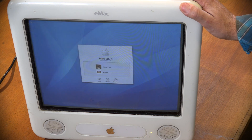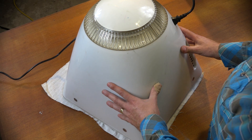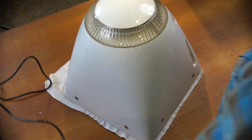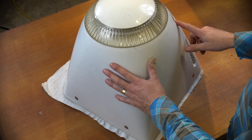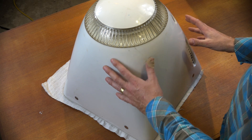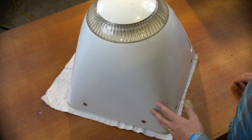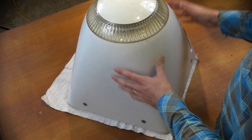I'll power it down and pull it apart - get the original hard drive out to return to the owner so he can recover his files, and put a fresh hard drive in. I'll flip the unit face down on a rag to avoid scratches. First thing: unplug the equipment - whether you have 110 volt or 240 volt like we do in Australia, it's enough to kill you. Also be aware that a CRT retains a lot of voltage inside the tube - don't go sticking fingers or screwdrivers where they shouldn't go.